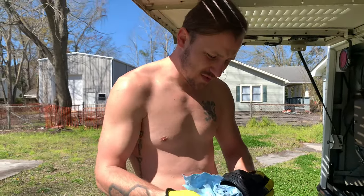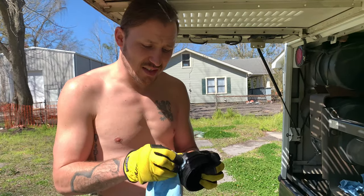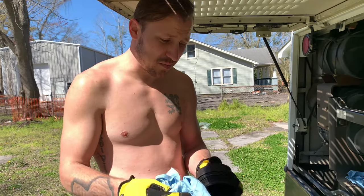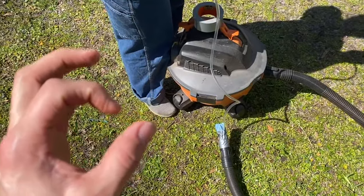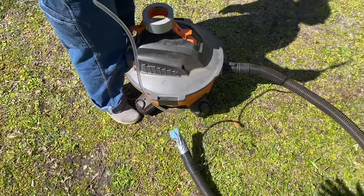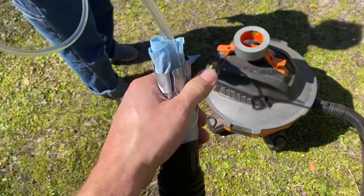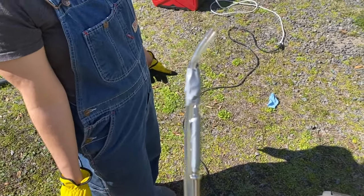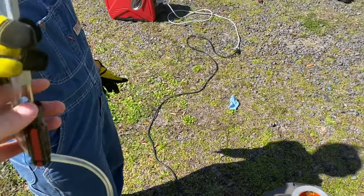We are cleaning the inside of the fuel filter housing first. We don't want to prime anything until we get this cleaned and get diesel back in there — we don't want to push air through. We have a shop vac with some hose running through it, with towels taped up nice and tight. The hose then comes down to a screwdriver to make it a point, so you're able to get the hose in there and suck out all the particles. Hopefully this works.